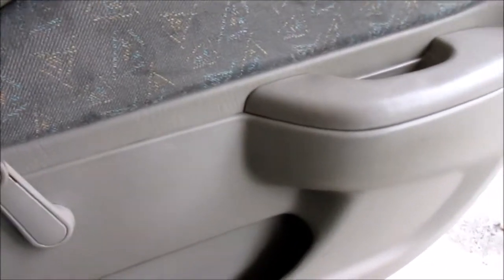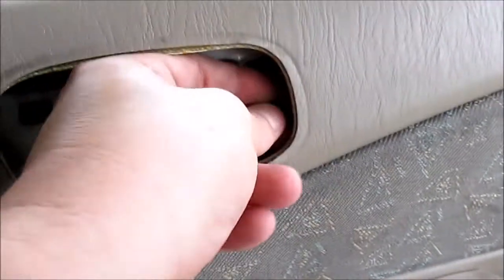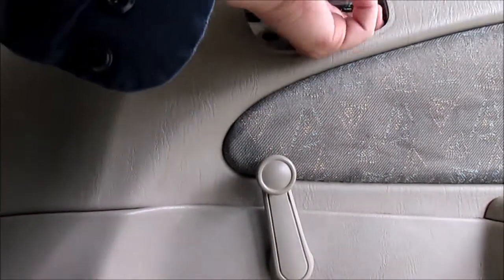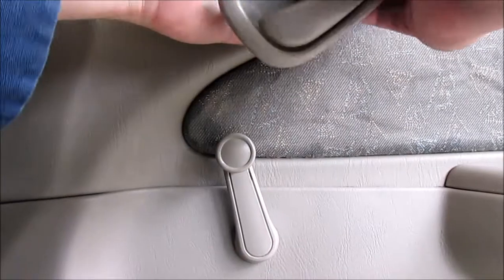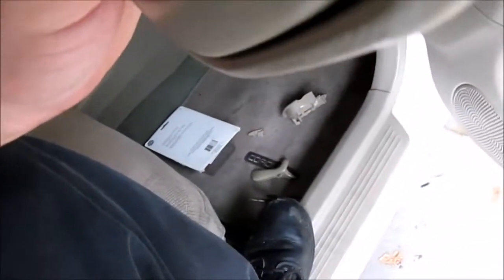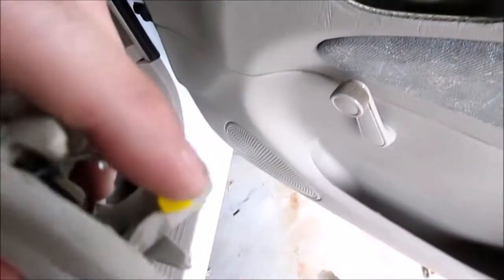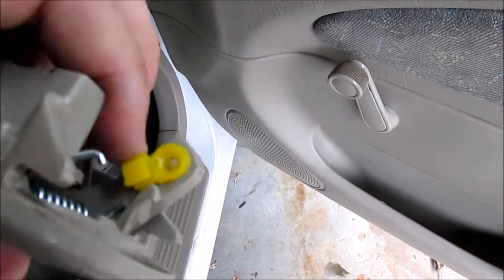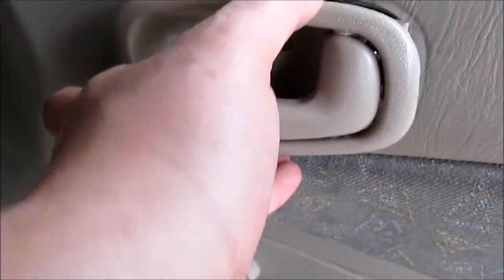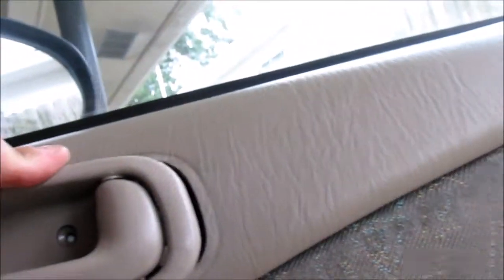There's a broken piece of the original door handle. Take the rod and maneuver the new door handle — you want to maneuver the rod down into that hole with the yellow clip. Bring the yellow clip back so we can fasten it over the rod when we get it in. You can pull the rod out a bit to make this easier. Basically stick the rod down in there, push the clip in on it, then set the door handle.